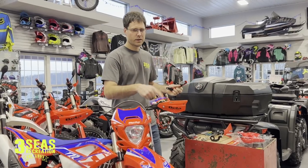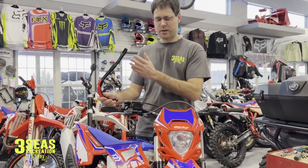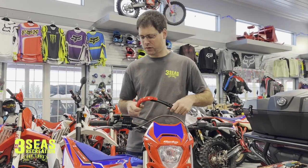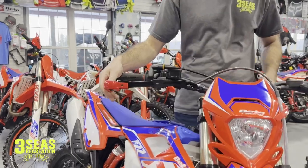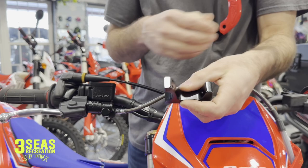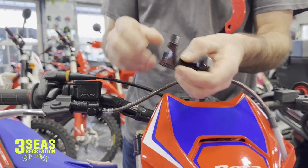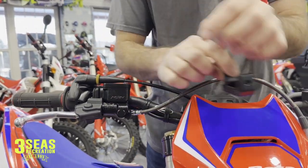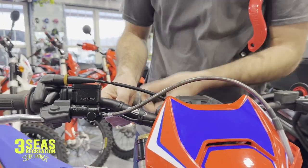The first step you want to do is dry fit these to the bike. I like to start with the throttle side because there's more stuff to go wrong — I'd hate to see you get completely done with the clutch side and then realize it won't work over here. Take the Pro Bend bar and set it up here. Keep in mind these mounts that go on the inner handlebar are tapered — they go from smaller to bigger — and that matches the bike. You have to make sure you have the right side because there's one for each side. I've seen too many trade-ins where these are swapped around.